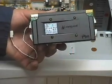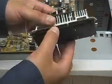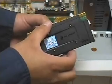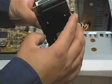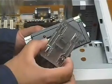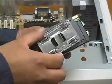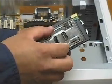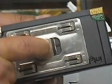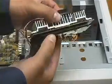Other CPUs like the Pentium II or the Celeron SEC come with different mounting provisions for their heatsinks, but the installation process is very similar. Make sure that you get the orientation right the first time, because the heatsink is very difficult to remove once installed. After you place the 4 legs through the card, use some force to compress the backing plate springs enough to lock on. This backing plate locks the heatsink to the processor nice and tight.